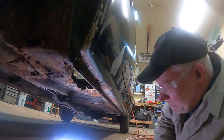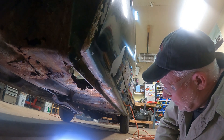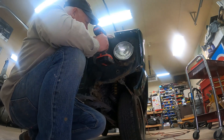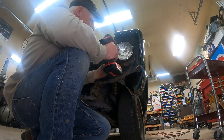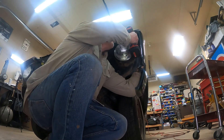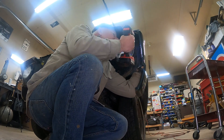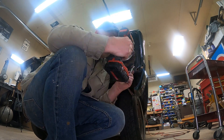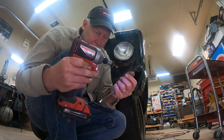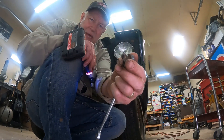Takes care of that. I hate doing it, but the worst problem is now I've got to go put another weld nut behind there later. Here's something that kind of stinks about these — especially these three bolts here. You've got to get a half-inch wrench snaked up behind here all the way up there and back these off, because they're not J-nuts or anything, they're just regular nuts. Makes it a pain to get these things out of here.